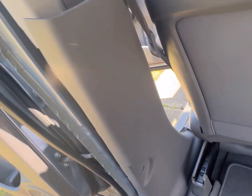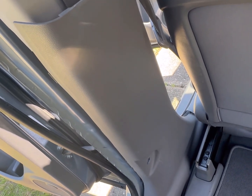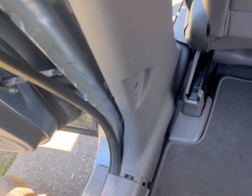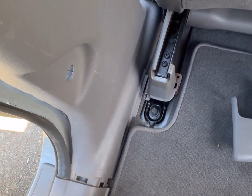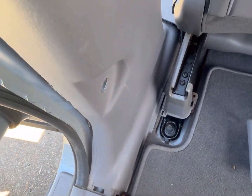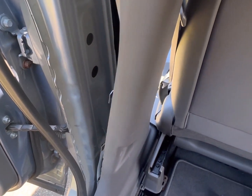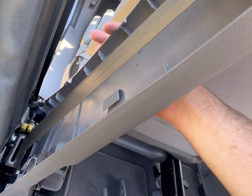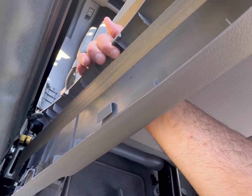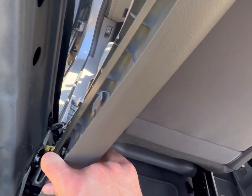You're going to be operating on both the rear door and the driver's door, so you want access to both sides. I removed different things that were in my way — went ahead and took that plastic panel off, moved the floorboard out of the way. Once you have that screw removed, it's relatively simple. Peel this off — you have some clips on this side that hold it in. Just pull back and remove these clips. There's nothing else mechanical holding this in other than these clips.